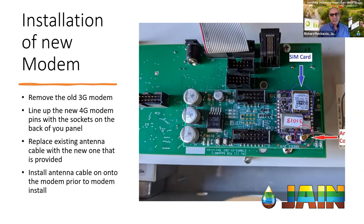Let's define 'a little resistance.' If I'm really having to strain, I'm doing something wrong — I should apply just a little bit of extra pressure and it should pop out fairly easily. It's not like it's been riveted in there. Correct — it's tight fitting so it doesn't move around on you, but you're definitely not giving it all you've got trying to get it to come loose. If you're having to pry it up with a screwdriver or some other tool, something's not right — and we could cause more damage on the CPU we're connected to.